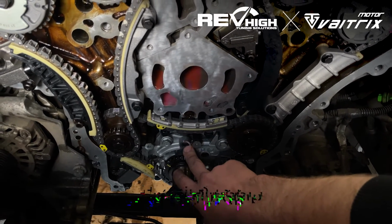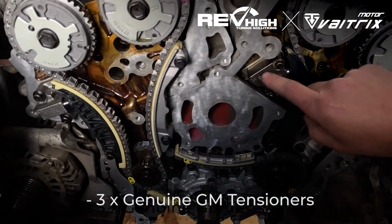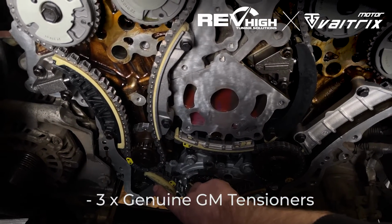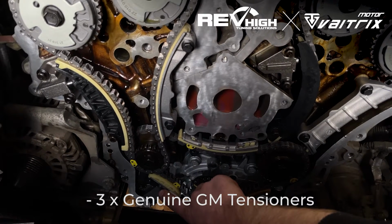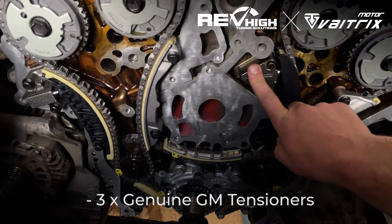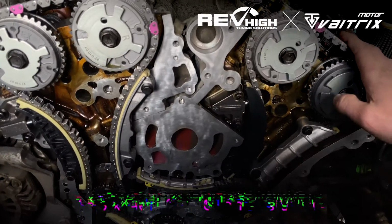They can wear out. We've got our 3 tensioners, 1, 2, 3. These are always recommended to swap out. A lot of workshops might replace them with the old ones. We don't recommend that. We recommend to replace them because they can cause a rattle on startup. So these are genuine GM ones, the latest revision. The chains are also the latest revision.